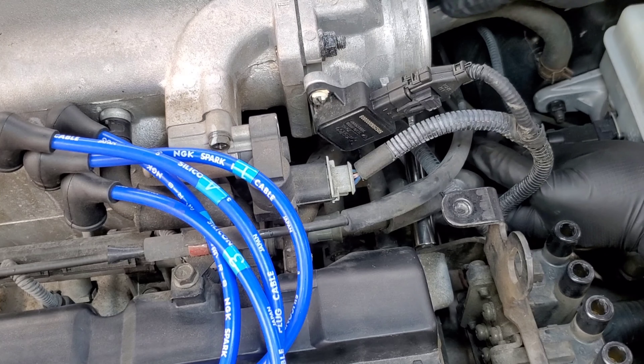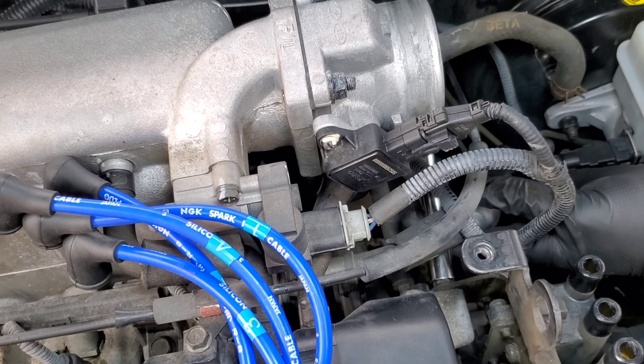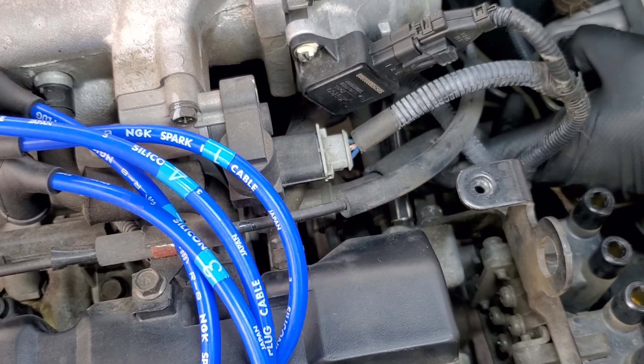As you can see it's a little loose now. Two bolts are located in the rear and you need a 12 millimeter socket for those. I previously cracked those bolts already so they're ready just to be screwed out. I'm going to show you how to put your ratchet back there — take your ratchet and put it under here like this, put an extension on that ratchet, and then you should be able to reach that bolt.